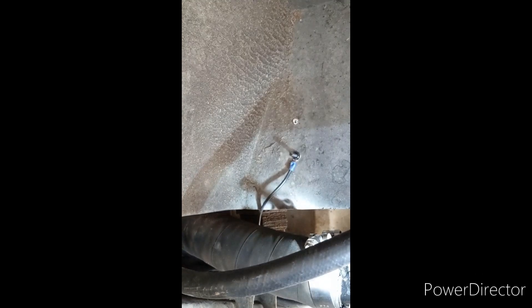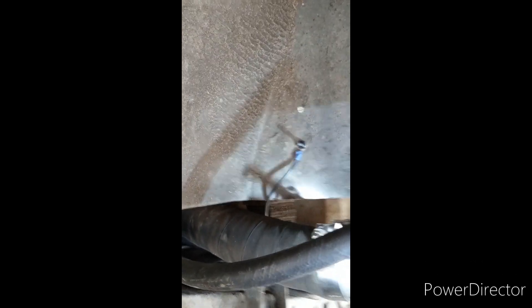New hoses, everything — as good as I could do. Did a slight extension on the filler neck, which wasn't just about extending it — it was more about changing the angle slightly. I'll insert a bunch of pictures of all the plumbing, the new holes I had to cut in the tank, the new fittings, and modding the filler neck to get this tank pressed up underneath here real far. Considering how tight the space is, it fits perfect. We have just a little air gap in there.